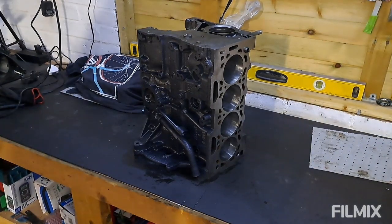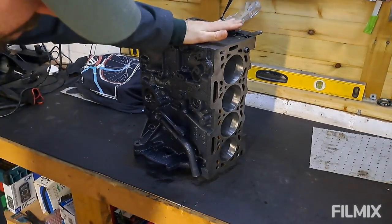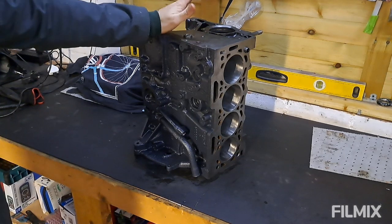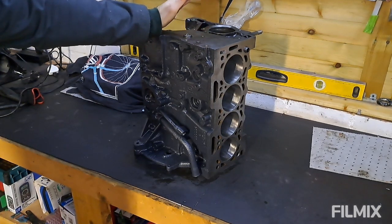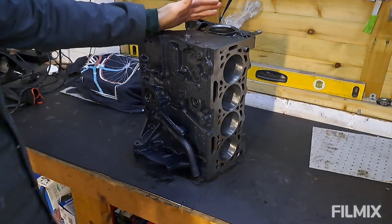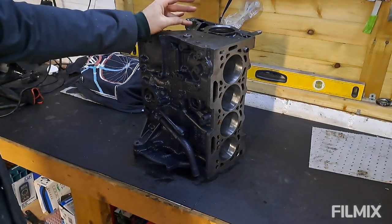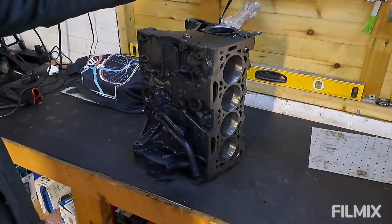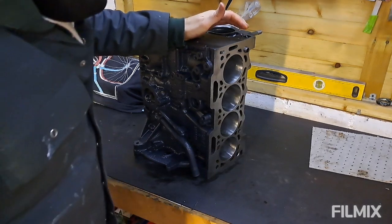Saxo fans, the block is back — been waiting a little while for this but I'm pleased to say it's now back in my possession. I used a company called Sprint Engines, based just up the road from me in Rugby. If you need somebody for machining work, highly recommended. They stuck it in a big barrel of de-rusting fluid, got rid of all the old detritus on the block, went in and out a few times and was washed a number of times. Then it was bored out for the bigger piston, so this is now officially over 1600cc — 1607cc if you believe the Wossner website. And then obviously it was re-honed as well.